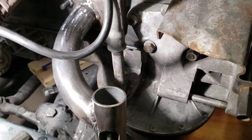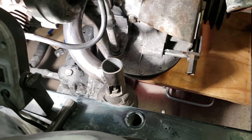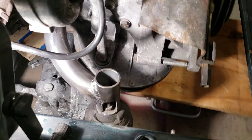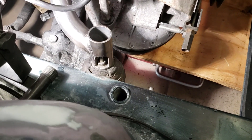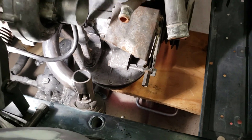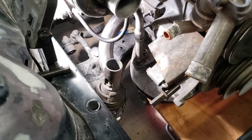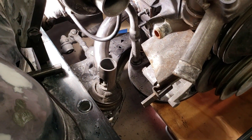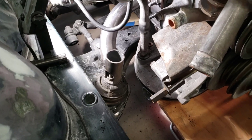Let's see how it turned out. There it is — that is our motor mount, and it's exactly what I wanted. I forgot to trim the top, but it's just fine — I'll match the other side to it. It should be extremely strong. No welds were ground down; it's over-welded and extremely strong. The other side will be a bear, but it'll really be the same process — just spinning the tube. I'll probably have to have a seam in there, which I don't like, but for this horsepower I'm okay with it. Then I'll weld it up to the perch just like I did there.